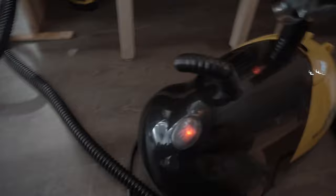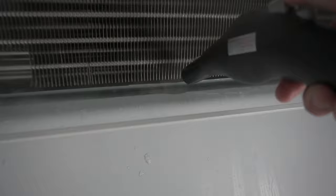I'm going to be using my McCulloch steamer — I've been using this for car detailing and flooring, and this is the perfect tool. I think this is the safest way to defrost the ice because a lot of people use hair dryers and heat guns, but this is a plastic panel and there's a possibility you'll end up warping or melting the plastic. Also, a hair blower is electronic and if it gets wet there's a possibility you might get shocked. With the steamer you can get the handle wet and won't get shocked at all. Now I'm going to use the steamer to defrost that huge block of ice that accumulated on the top.